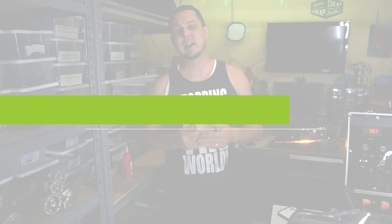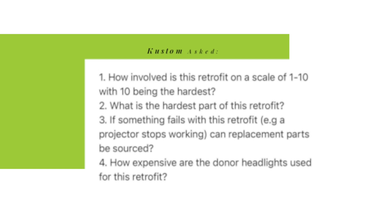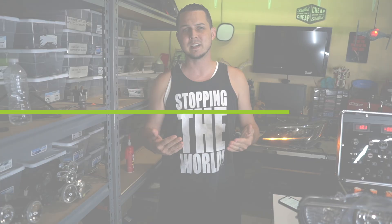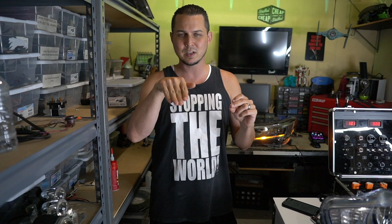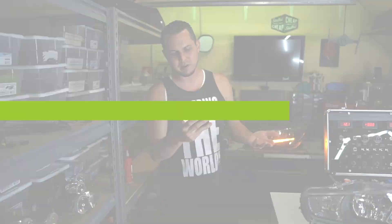Next up, a question from Custom LED Creations in Trinidad and Tobago: on a scale of 1 to 10, how hard is this retrofit? Let me just take away any doubt — it's a 10. It's the hardest. You're not going to find a harder retrofit because there's all these different mounting points, all this stuff that you can do incorrectly. To perfectly have three points of adjustment — like a ball joint, a top up-and-down adjustment, and a left-and-right rotation — all three points have to be exactly at the right pitch so it doesn't push out light onto the road diagonally. You do everything perfect, but then you mount it on the car and don't realize the headlight has to be rotated because of the way these lights are built — now they're crooked. You probably need to have the actual car if you want to do this perfectly, or you have to do the same type of light over and over again.